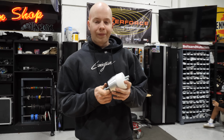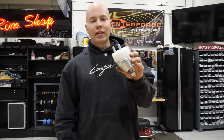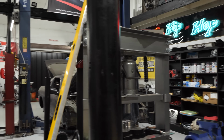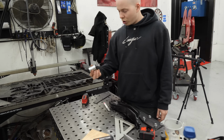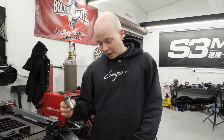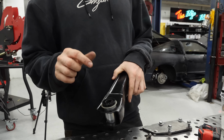So unfortunately, I'm not gonna be able to use these fish motor mounts. Not too surprised, these are meant for an IS300 with a 1UZ swap. Clearly, IS300s are much wider. Now, the unfortunate issue is that I wanna keep working and I don't have any other bushings besides these bushings, which are off Hunter's car. He's got some spare bushings and spare control arms. They go in there, press in like that.